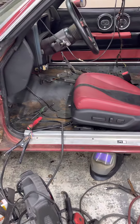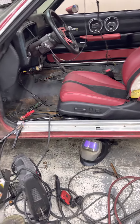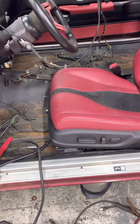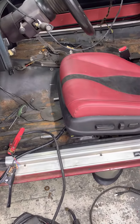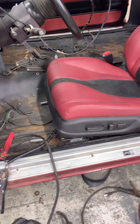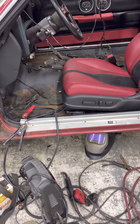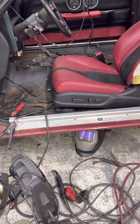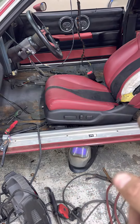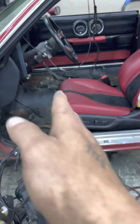It's things like this — rushing. I've done a lot of these seats, but I still make mistakes. I wanted to share it with you guys because nobody's perfect. It's been a long night, I'm in Ohio, it's like 12:15, been working all day, had to go to the junkyard first to get the seats out and get the car stripped. So just something to think about when you're installing seats like this — always make sure you've got the seat moved all the way back before you tack your brackets in, to make sure you've got enough leg room.